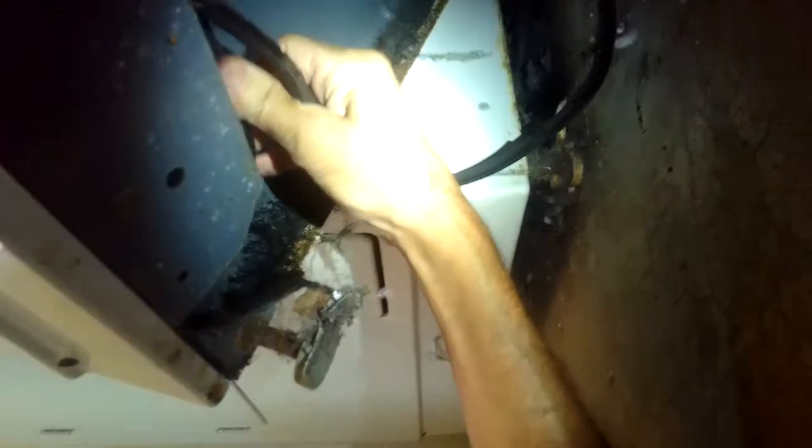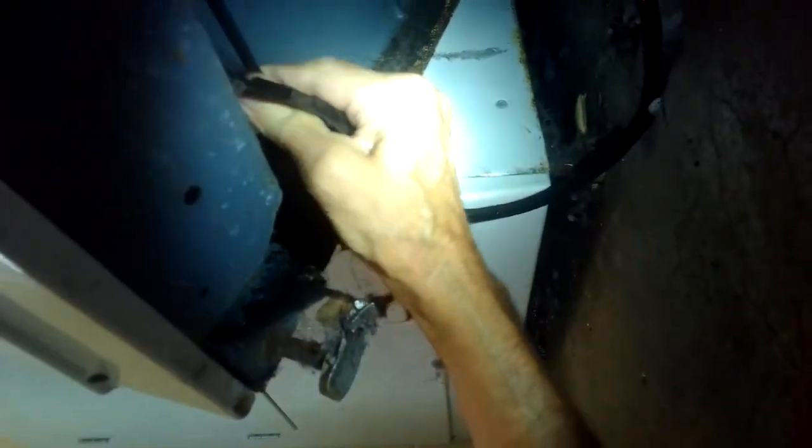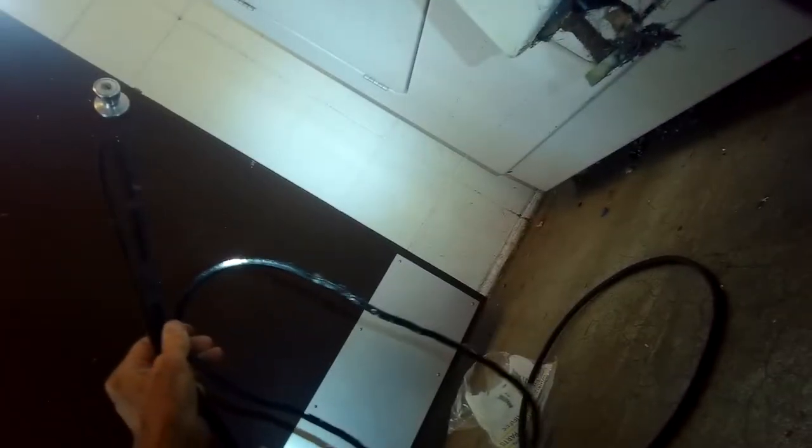We took off the one that goes to the big pulley, which is what makes it agitate and spin. Now taking off the skinnier one on the pump. I notice the pump belt looks pretty good, but the one making it agitate and spin is really shiny and cracked. They did complain of a burning smell.